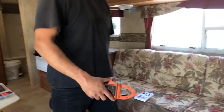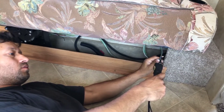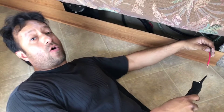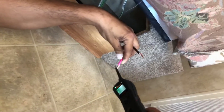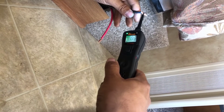Amperage doesn't drop. Now I'm going to go over and test for amperage, but first I want to see which wire is power and which is ground. Have her press that same button. We'll check which of these wires is power and which is ground. Go ahead and press it. One of these wires should be power - but neither one is showing power when she presses that switch.